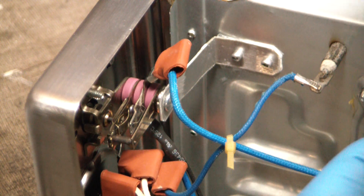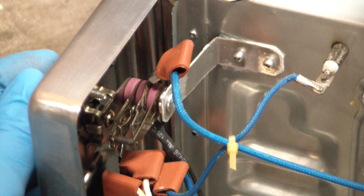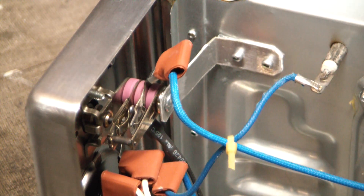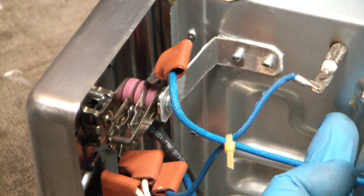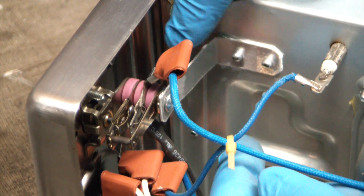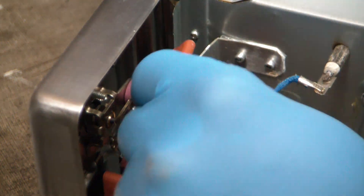I don't mean to get distracted, but this is a pretty cool little engineering design. If I heat it, we should see the relay disconnect, right on the edge — once it hits the set point. That is an ingenious and cheap design — no actual electronics monitoring the temperature, it is purely this bimetallic switch and conduction through a little aluminum tab. If they were trying to be super accurate they'd probably use copper, but it's a toaster oven, you don't need to be all that accurate.